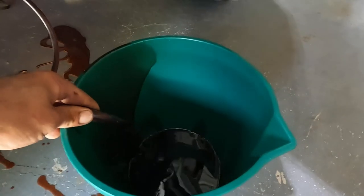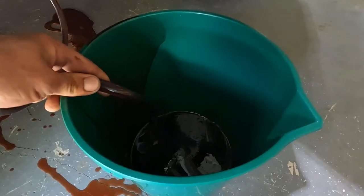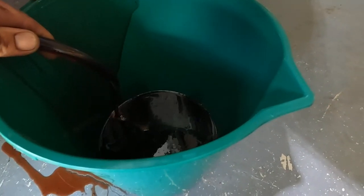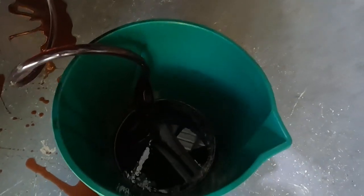It pays to hold on to the bucket! This is real world people — this is what happens when you're doing it on your own. Be careful. Obviously if you've got someone else helping it's great to go through the gears, but anyway we'll keep going. We're going to fill the transmission again through the fill plug — the same amount we just took out, about a liter and a half — and we're going to keep doing this a few times until the oil coming out is a lot cleaner, like new oil.